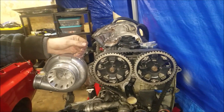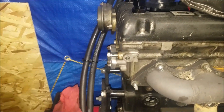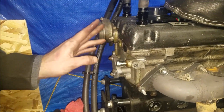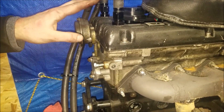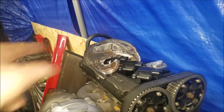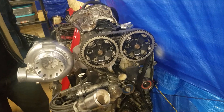There's a little bit more to it — we're going to have to pull the head. We actually made a block-off plate for the thermostat water neck. You've got to pull the head and drill two coolant holes in the back, because it'll create steam and you don't want that — this area will get hotter with less circulation. You don't want to create a hot spot because that cylinder could get hot and detonate, and that'd be bad.